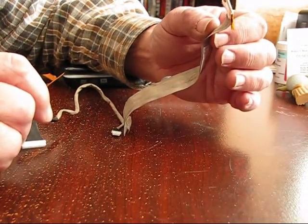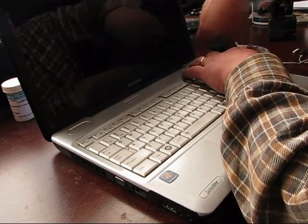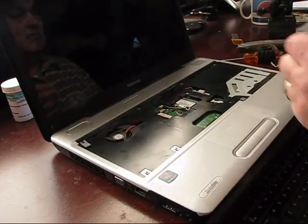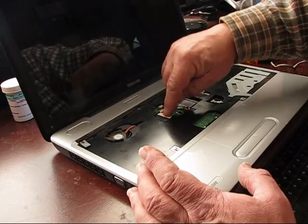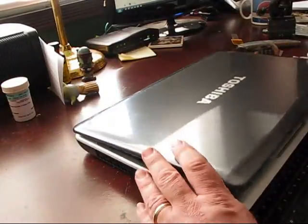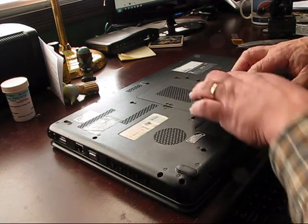Let's go ahead and get the computer dissected and replace this cord. We're going to take the screen off. This plug right here — that is the plug we're unplugging. We need to remove everything off the back. Battery out, and I've got a new battery coming in.